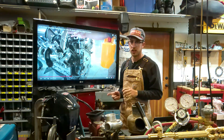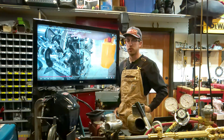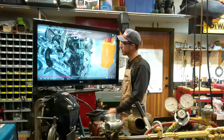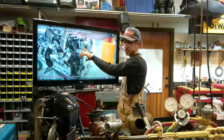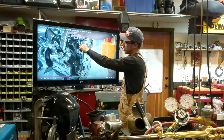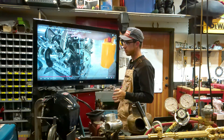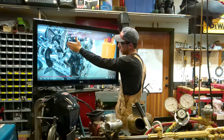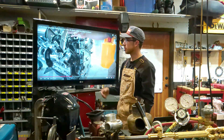There are products like a throttle body intake cleaner that work really well — I'd say every 25,000 to 50,000 miles, that'll help. But it's just another thing you have to do. One of my biggest concerns is the high-pressure fuel pump — expensive to replace and destined not to last overly long because there's no lubricity in gasoline. You've got a potential failure point where gas can get into the crankcase, dilute your oil, and flatten cams. The days of your $30–$40 injectors are now gone.